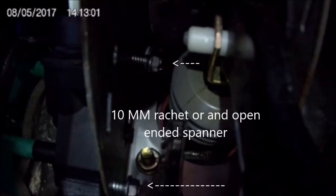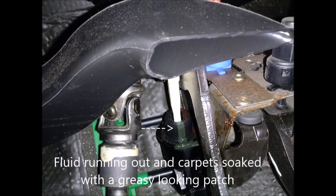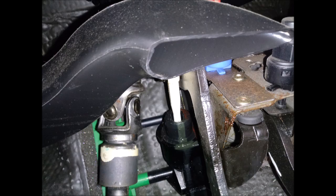The two bolts underneath are really awkward to get to. I'd suggest a ratchet style spanner - they're going to be a nightmare with a single spanner as you've got very little movement on it. That's where you're going to start first. Get under there, have a look, confirm it's leaking. Get yourself a new one - they're not expensive.